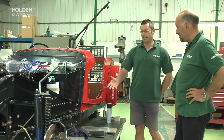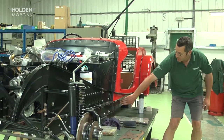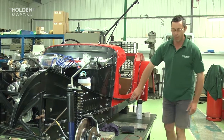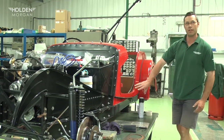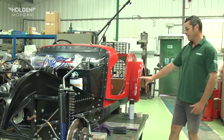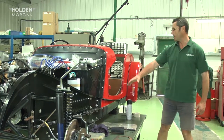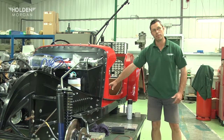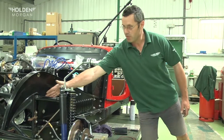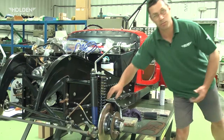As with the basis of nearly any car, the most important part is the chassis. This part under here — steel, not wood. It's always been steel, never been wood; it's a complete fallacy. The first thing we had to do after we dismantled the original car was to make the chassis sound, particularly given the use that this is having. It was reconstructed basically around some of the original parts; the side rails — we had to put a couple of new cross members in to make it back to proper strength again. This part here, which is the crosshead on which the front suspension hangs, was modified down here to give us more ground clearance.